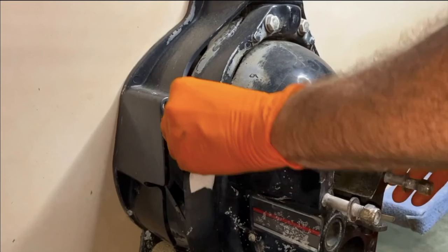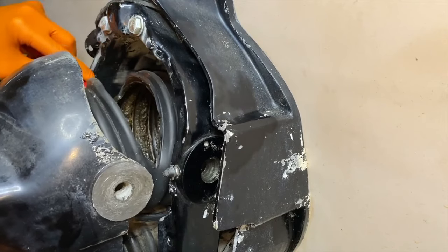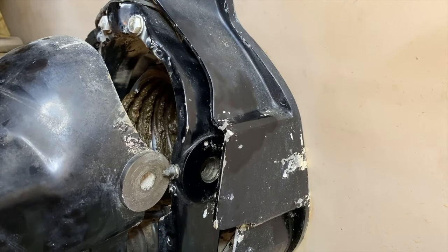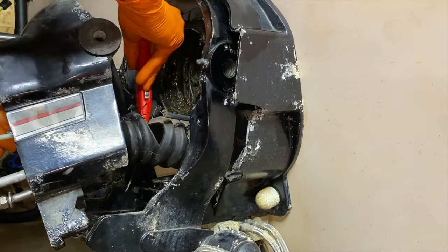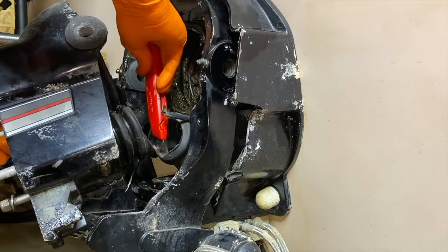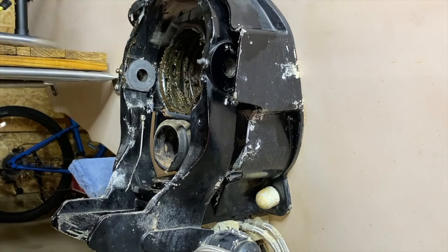In this video I will show you a quick view of us cutting the bellows with our Craftsman utility knife so you'll at least see how we cut through all the bellows and remove the bell housing. Just cut all the way through — now to the opposite side — cutting the entire bellow. There we go, and we will pull this entire bell housing out and set it in a safe location.